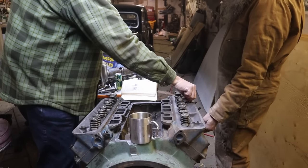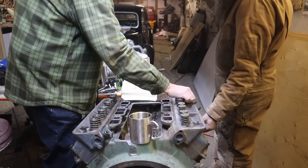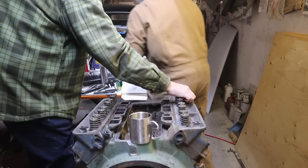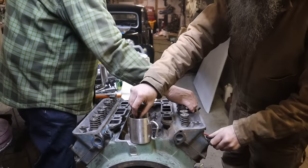And he was right. He's like, the only reason I dyno my engines when I build them is so I can fix the leaks if there are any. It's a good idea. And I don't really care, because if you set it up right, you shouldn't be finding huge amounts of horsepower that you were missing. You can try a little timing, try a little of this and that, but Ash said too, when he built his Datsun engine, they pulled a couple of times, and he got it to make the exact advertised horsepower on that little Nissan engine. It's supposed to be 175 at like 6,500 RPM or whatever it was, and he got 174.9. That's pretty tight.